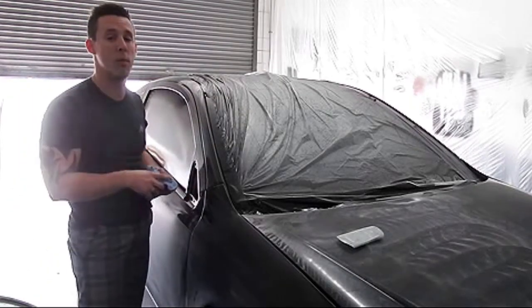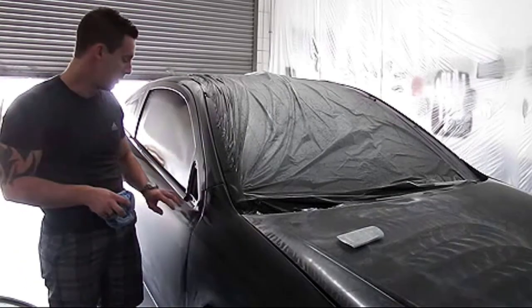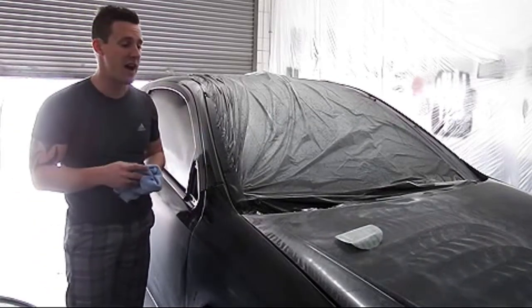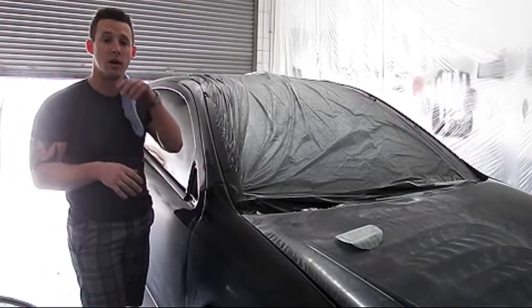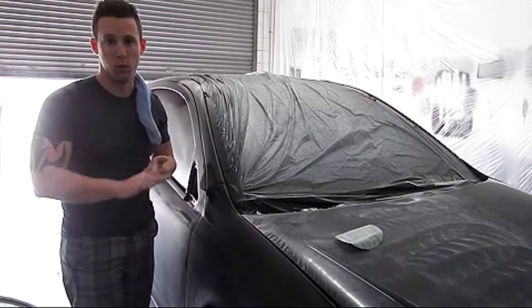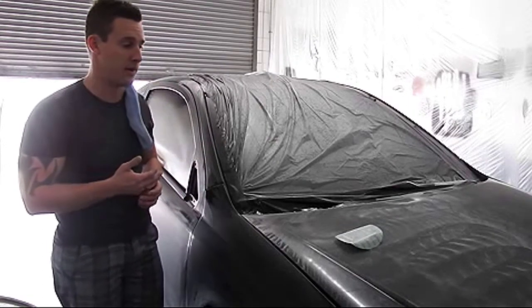If you're talking about going all the way around the car — especially on flat surfaces like doors and hoods — using sanders those go much faster. Each door maybe five minutes, the flat part maybe two to three minutes. It takes us about an hour and 45 minutes to two hours to do the entire car. Once we're finished, the next step is to re-degrease it, give it an alcohol bath, and then we're going to slap another layer of gloss on top.